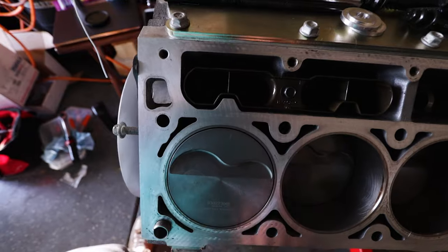So now to do this we're using the clay method first, and we'll be using dial indicators too, but clay is super cheap. This is just basic modeling clay we picked up at Walmart for about a dollar twenty-five. You definitely don't need this much - we just need enough to basically fill those little valve reliefs, then we're going to use this as a way to compress it and measure what the clearance actually is.